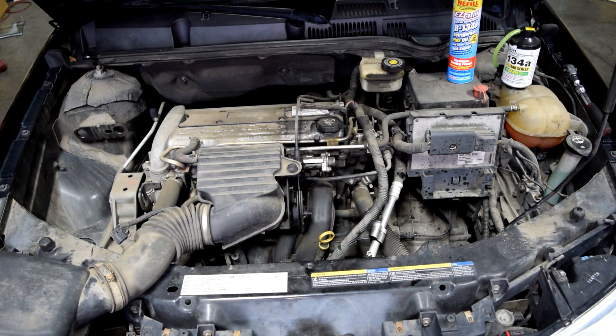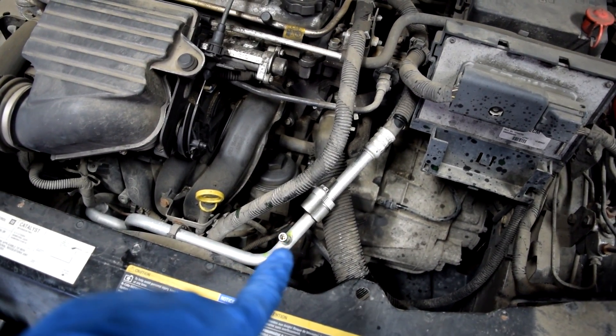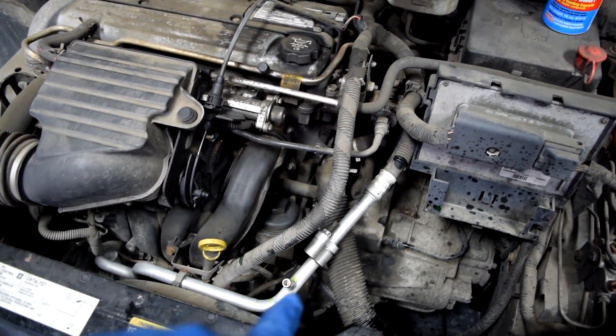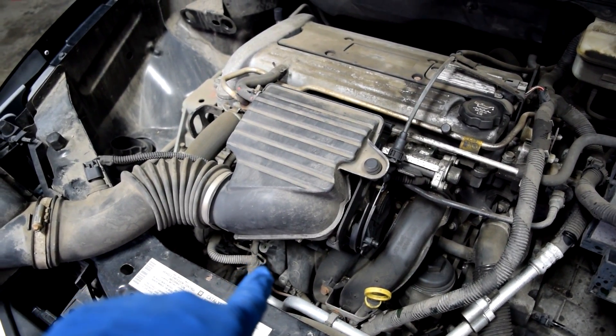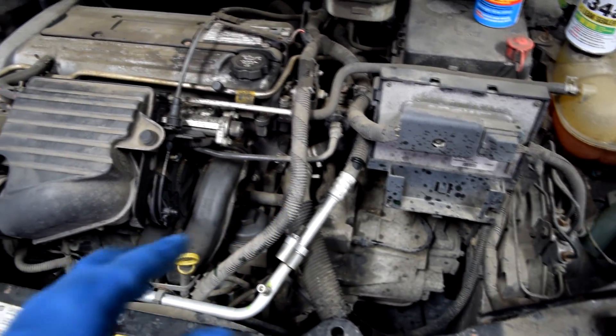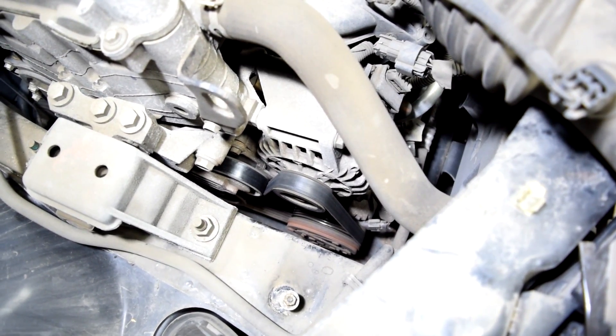Next, you'll need to turn off the lights in your garage, and then using the UV light, go around all your different AC lines, your AC compressor, and your AC condenser. If you have a leak, it will stand out like you're seeing here. This is our pressure port on the low side — this is where we added the UV dye — and you can see exactly where that refrigerant splatters around. We even got some splatter on this plastic housing by our fuse box. When looking for leaks, some of the main culprits are going to be that fitting, the little valve inside it — both on the low side and high side, they tend to leak. These lines themselves could spring a leak wherever they connect to something else, like where the line goes to the AC compressor and then to your AC condenser and receiver dryer. There are little o-rings around those lines where they hook into other AC components, and those could always leak. Also your AC compressor itself can spring a leak, so make sure you check that as well.